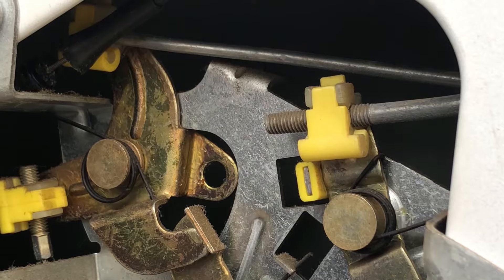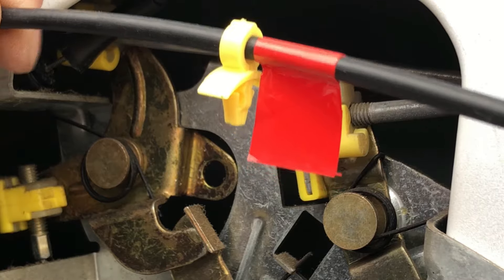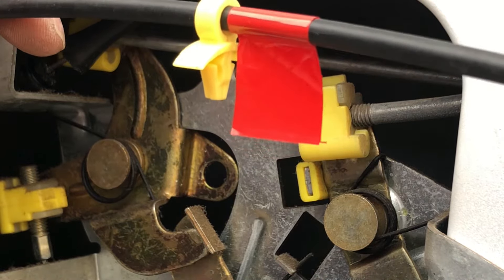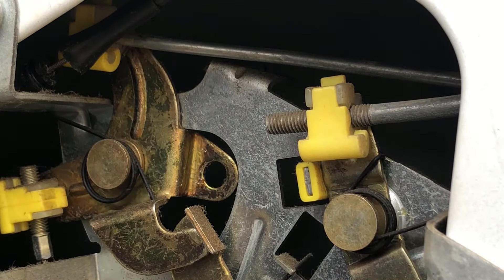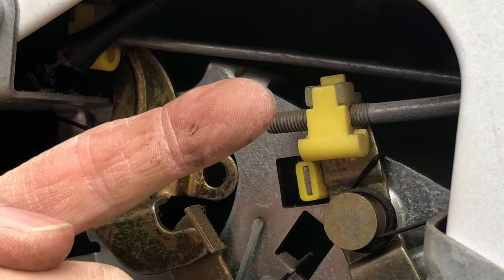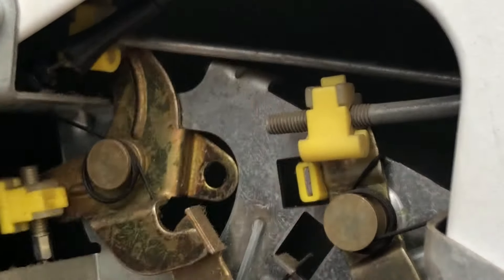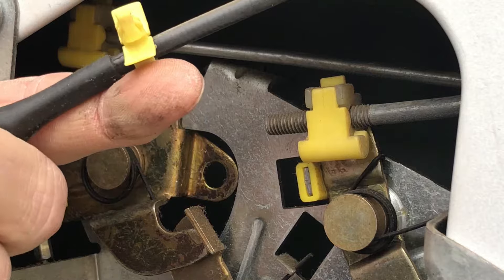I'm going to keep this clear plastic piece, pop the little yellow clip up, and it slides right off. Now up inside the door there was a yellow clip pushed inside the door frame. Before you take this cable out, look up in there and see where it is, because you will have to reinstall it in the same place. I can't get a camera on it to show you, but just look before you pull the cable out and remember that.